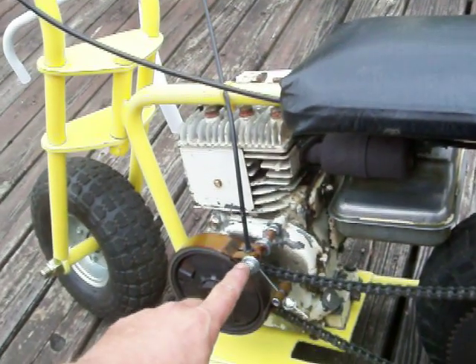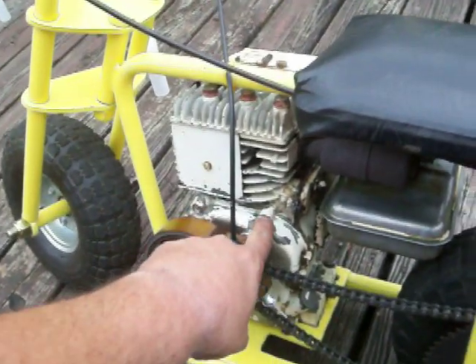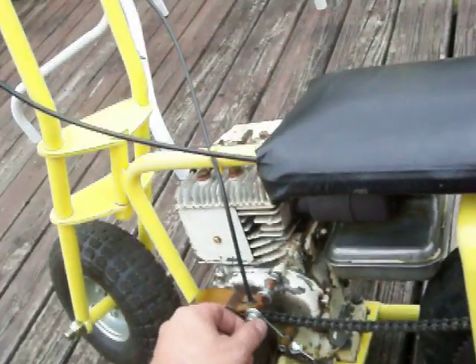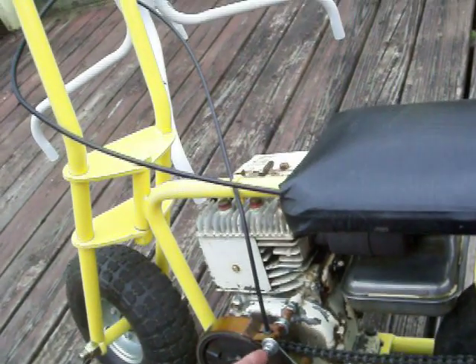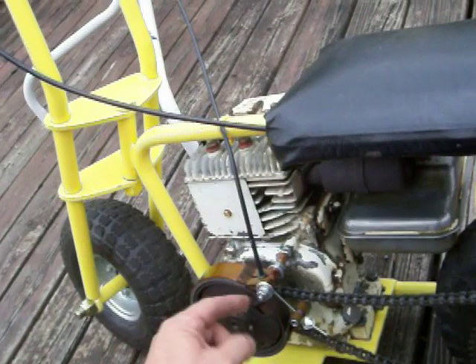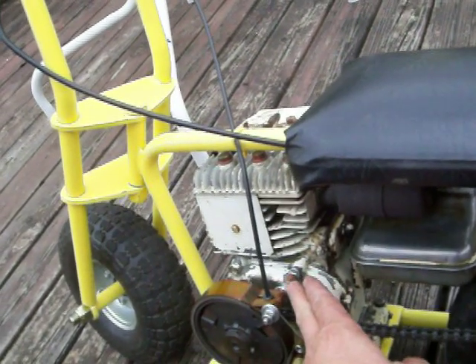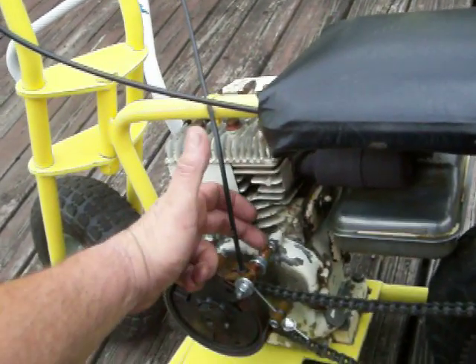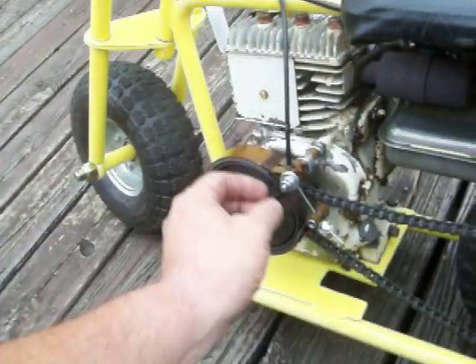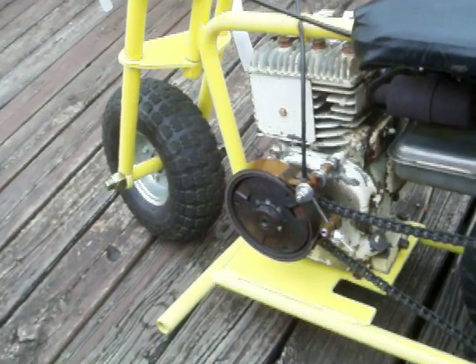On your two to three to four horsepower Briggs, all you got to do is back out and remove this top right hand bolt from the side cover. Cut and measure your quarter inch piece of solid rod, screw it in, and washer it up to where the band will come out perfectly level with the clutch. One of the simplest things in the whole wide world to do.